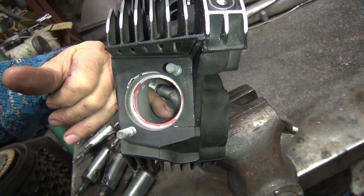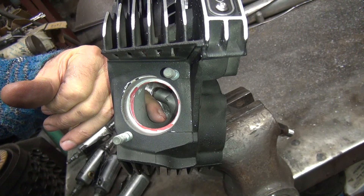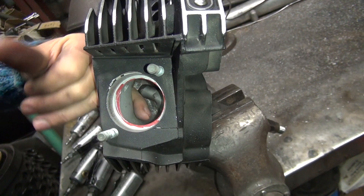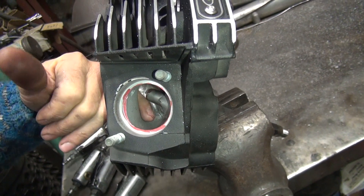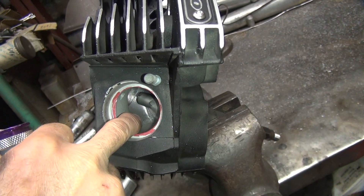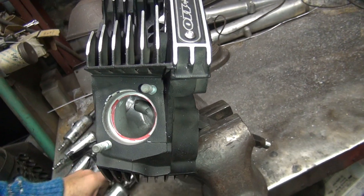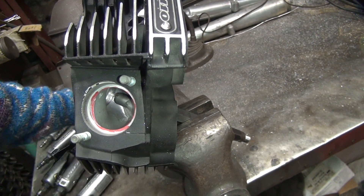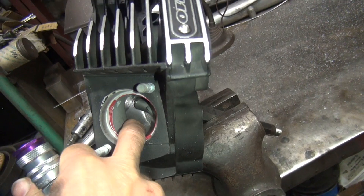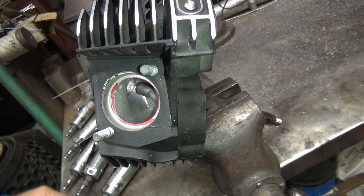Because the exhaust is coming at what speed? About six, seven hundred feet per second. Six hundred feet per second? Yeah. Holy shit. That's pretty quick. Yeah, maybe it's only three or four hundred feet per second at low speed. High RPM you can hit — you can basically make it a carpool lane for air to go. The more restricted the port is, you can hit supersonic speeds inside your port which really gets restrictive.